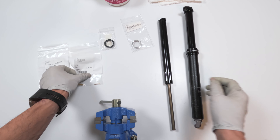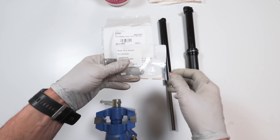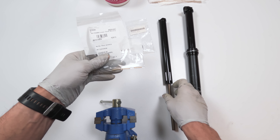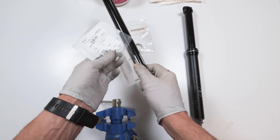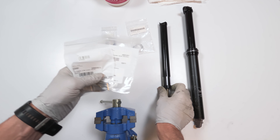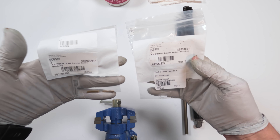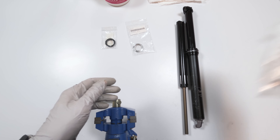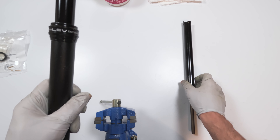If you want to replace your guide pins, the new pins come in two packages. My guess is because of wear — they'd rather have plastic hitting the bushing. So there are going to be two pins per slot instead of one: a metal one on the bottom and a plastic one on top. Be careful when ordering guide pins. Here are the part numbers in case you need them — hopefully that comes out clear. That's pretty much what we're going to need from a parts perspective.